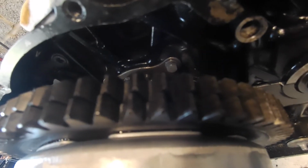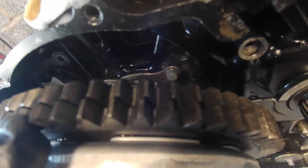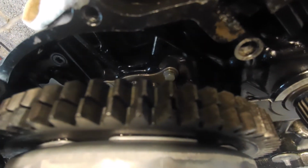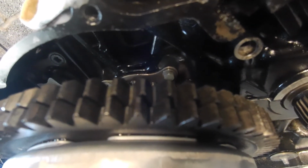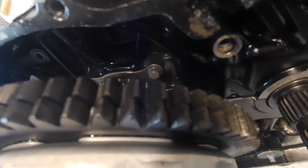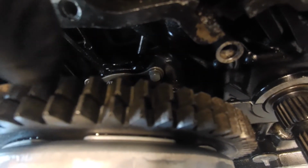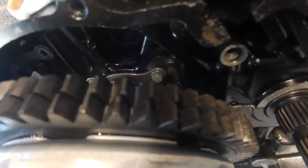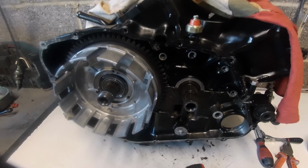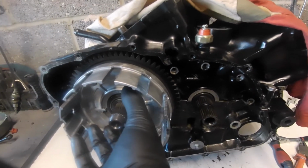You see what looks like a misalignment of them teeth. It's actually a gear. Even though spur gears have to have a degree of clearance, there's a spring-loaded section of this gear, and when it slides back into alignment, it's naturally in that position now, but what it wants to do is move slightly back. Okay, so we've got an oil pump drive in the 4 dog pins at the back of there.